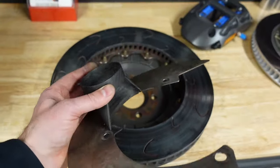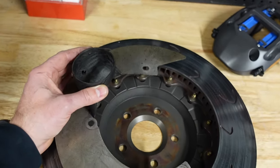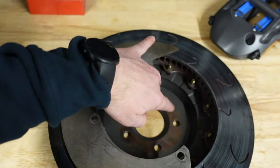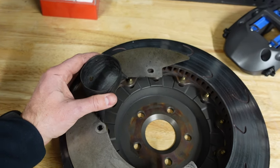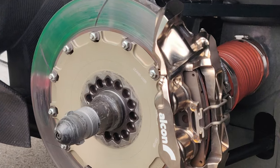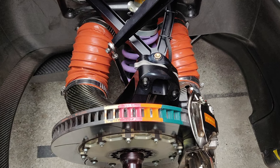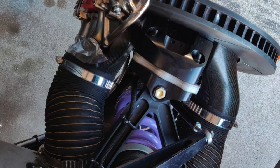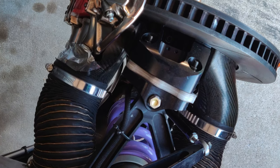One of the critical elements when designing a brake cooling system is the sizing of the ducts — the area through which you're passing air into the section of the disc. It's not unheard of in professional racing, certainly in large heavy cars designed for really high speed, to have three or four inch ducts, or even multiple four inch ducts, feeding air into this area of the disc to maximise the cooling.